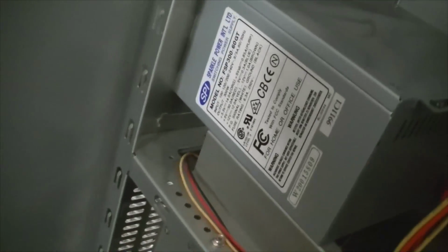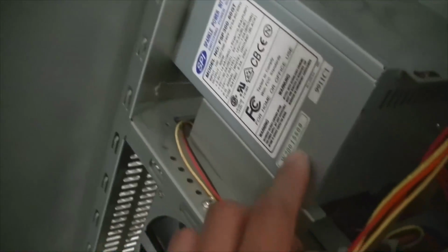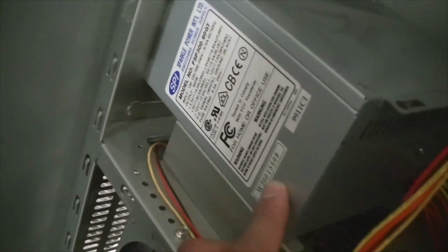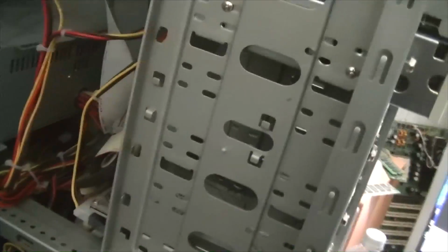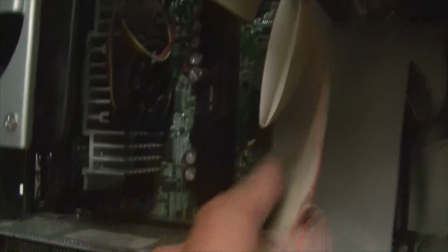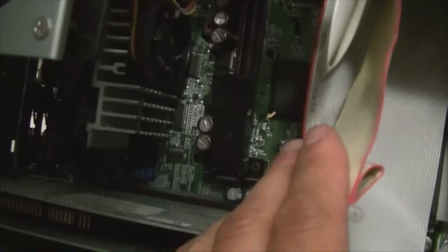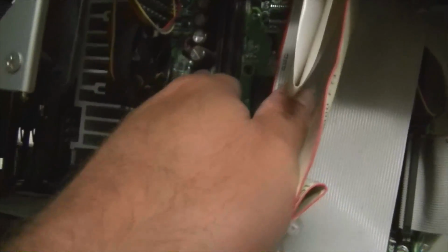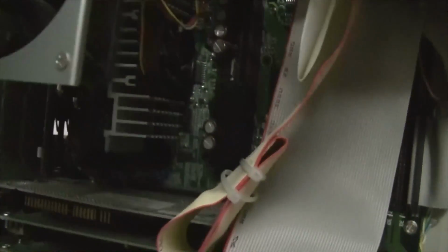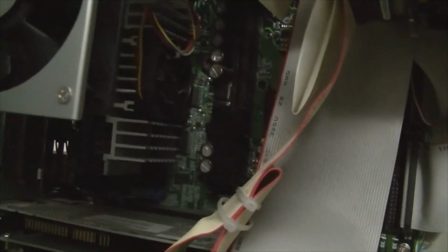I don't know if that 2001 is the year it was manufactured or not. I don't believe this was actually made that new. I think I've got another Pentium 2 450, although I can't seem to find it. So it might be at work. I'm thinking of just going ahead and shoving it in the slot, even though if I install anything other than NT or Linux or something like that, the second processor will get completely wasted.